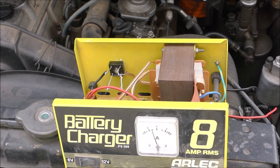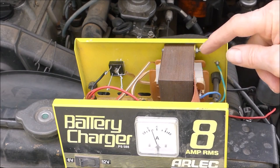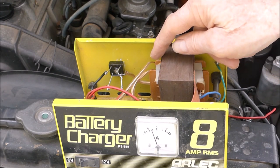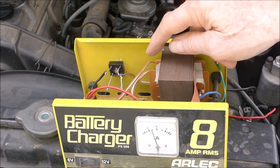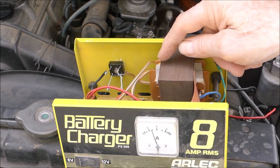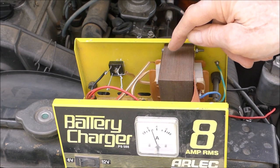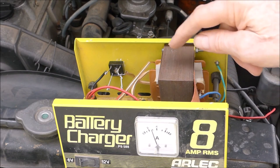Right, looking inside, there's a few things that can go wrong. The first thing to check is the transformer — that can burn out. You just check the output; there'll be three outputs: one will be the neutral and the other two will be actives. One will be 12 volts and one will be 6 volts — it'll probably give you a reading of 12.4 and 6.3 or something like that. If it's a really high reading, say over 15 volts, it means something screwy is going on. But in this case, I checked the output and it was within spec, so you know it's getting the power and it's all working.